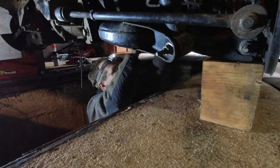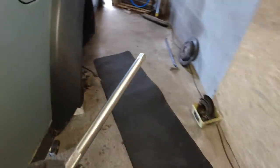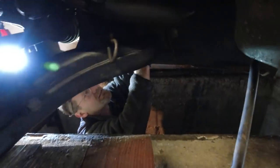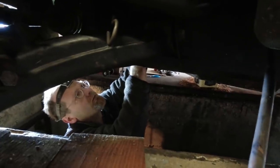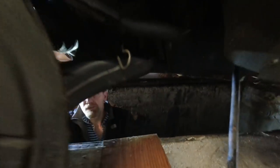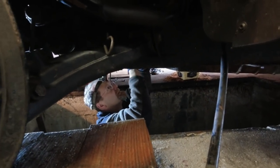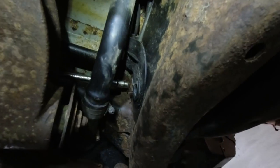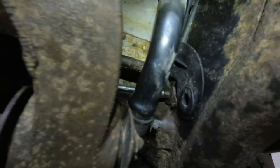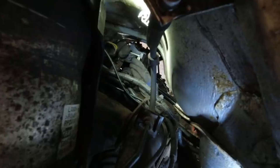I got the cable tight. A socket extension would work. I got this cable clip here and simply put the ratchet over here, then knocked on my 3/8-inch socket — ready to go again without any hassle. Now we can maneuver this thing out. Now I can pull these out because I got them all marked.